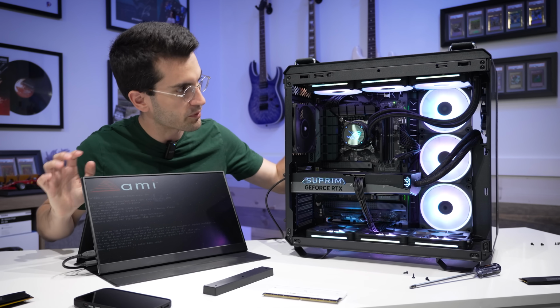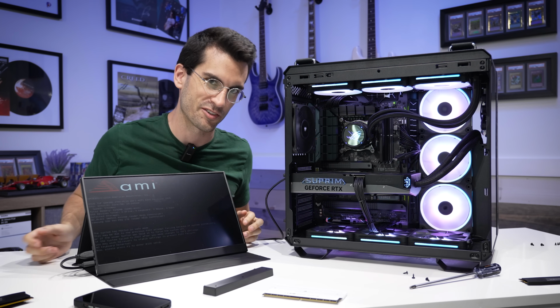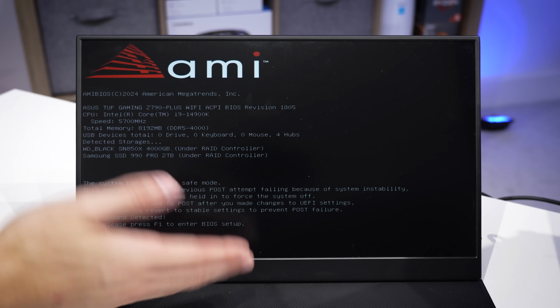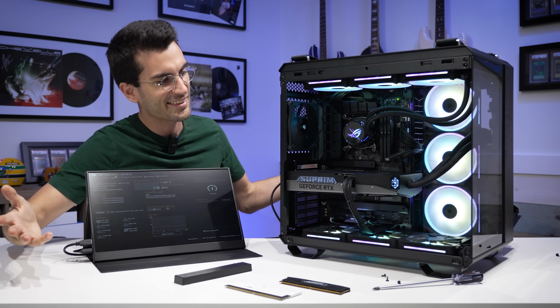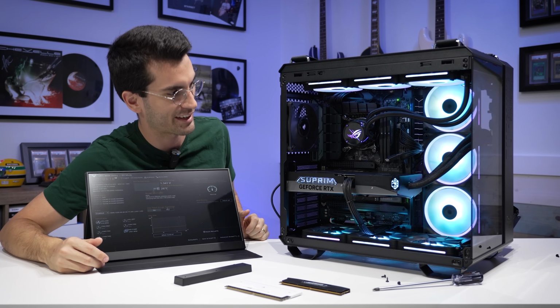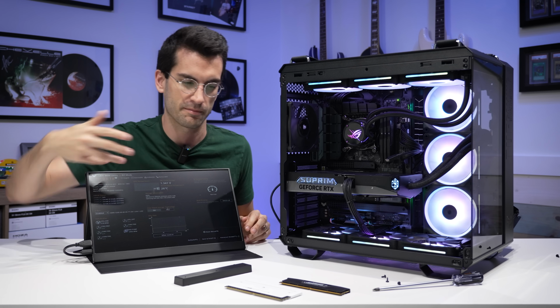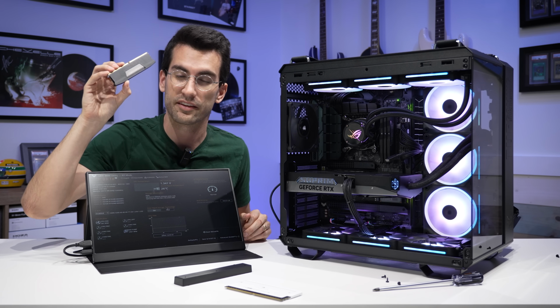We do get a post with the second DIMM in any slot, and again, no USB overcurrent. Separate issues, remember? And again, it's only throwing us in safe mode in the interim because I keep resetting the system to try different modules. DIMM 3 also works no problem in any slot, as does DIMM 4. In fact, all three of the known working DIMMs are connected at this point, and we still get a post. By the way, the numbers are just arbitrary based on the order in which they've been tested. So this first one is the defective one.